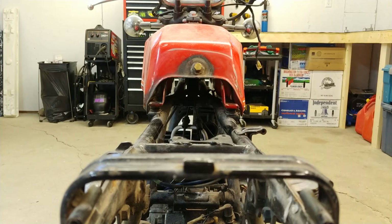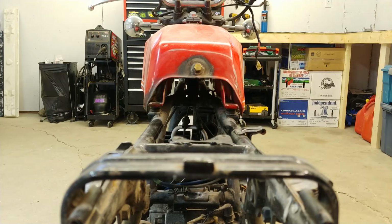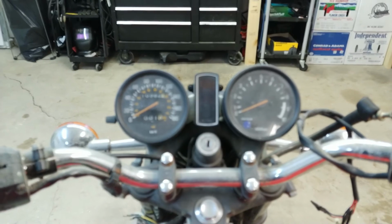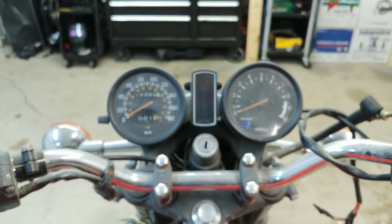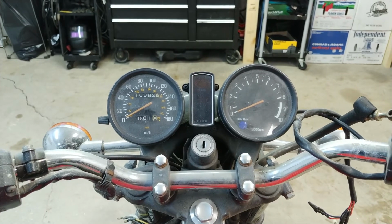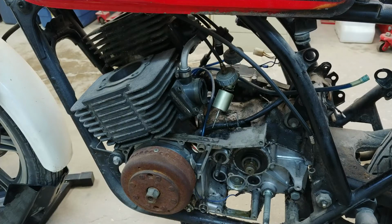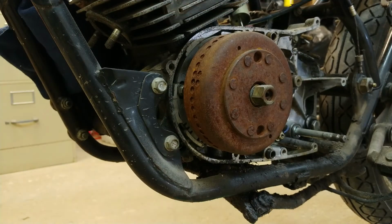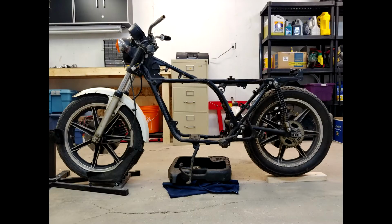There is some room under the tank with the airbox removed, so I'll be stuffing some Moto Gadget goodies under there because I won't be using the stock air cleaner. For the front end, I'll be ditching the stock gauges for something more modern and adding some clip-ons, also cleaning up the front fender a little bit. The motor itself will stay stock internally. Nice coatings for the cases along with electronic ignition perhaps should clean it up quite nice. And to finish it off, the regular trimmings on the frame and a nice set of expansion chambers.